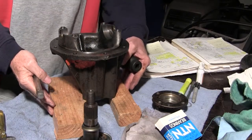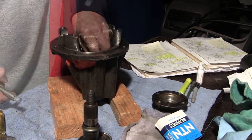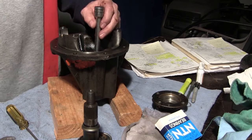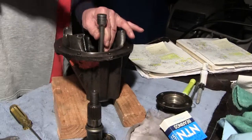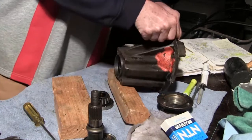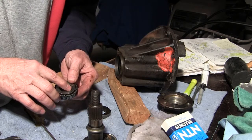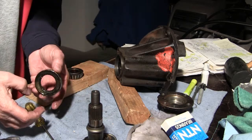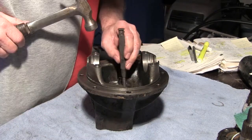Blocks for elevation. The front bearing is loose. My 29 millimeter socket fits in there inside the race, right up to the pinion bearings. Bearing will push out the oil seal. I can feel it moving. This is a Timken M84548, made in England. The oil seal is leather with little notches in the case, and the bearing race is under that.